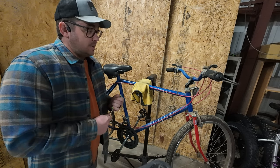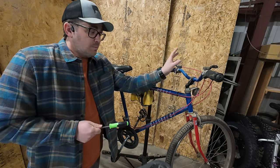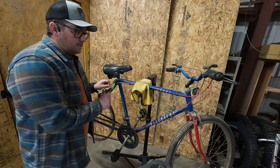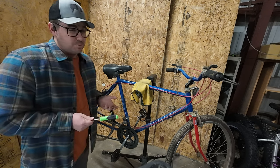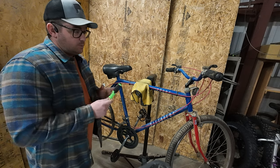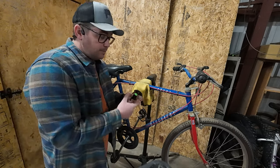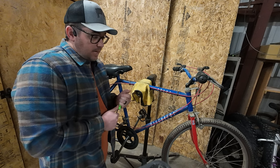To do that I'm really just going to be replacing these bars. I've got the Velo Orange utility bars with their utility rack. I'm going to throw that on here, then some new tires, some tubes, clean up the chain. Based on the condition of things, I don't think this was really ridden that much. I'm going to be putting an adapter in there so I can use a normal clamp to go onto those Velo Orange bars — this is going to be the most complex part since it's a threaded headset. But other than that, it's just going to be cleaning it up and getting it ready to ride.